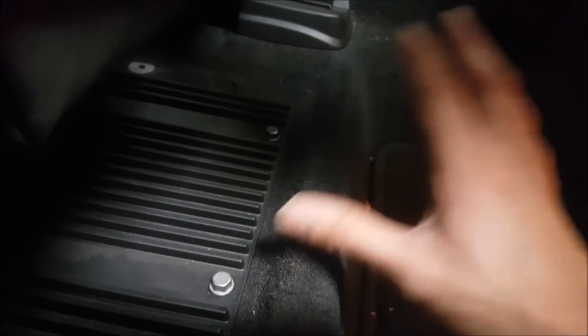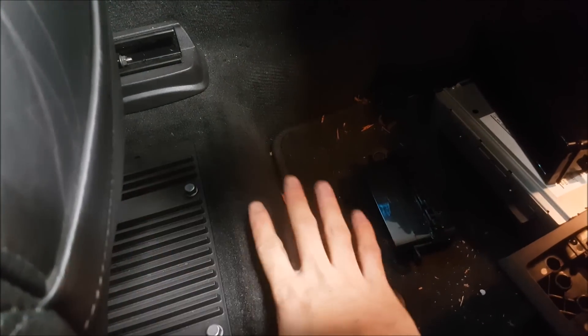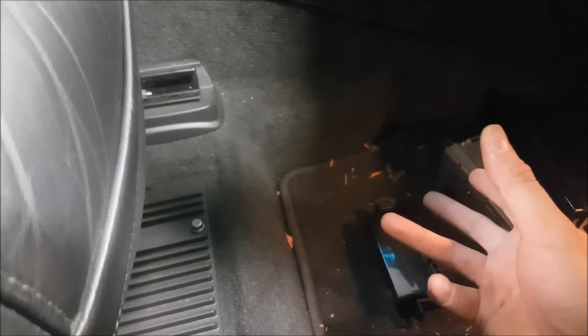We had to tap all our signal. Now the catch when you're doing a vehicle like this is that Volvo runs the SRS system through the head unit. So I actually have the factory head unit in there and we have to plug everything back in — all the fiber optics, all the plugs are plugged back in. That way you can cycle through the system. If you don't believe me, try doing one of these decks without any of that stuff in there and see what messages you get on the dash. We have no messages on the dash — everything works fine.